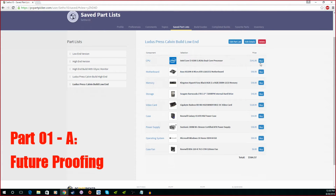We could have saved probably $20, $30 if we had gotten the one that said i3 5300. This one is not even much faster. It will give him 5% more speed or something. But he now has support for a memory format that is going to be used for a decade, instead of the tail end of a legacy memory format that is no longer in use at all.